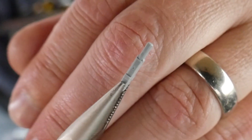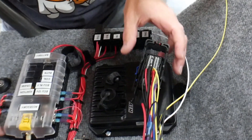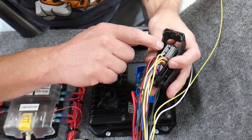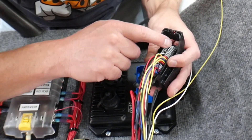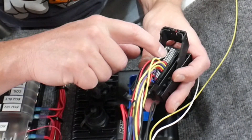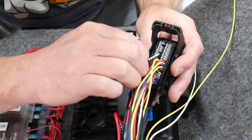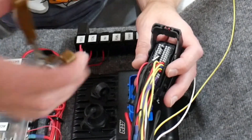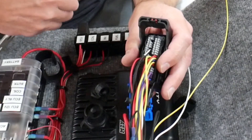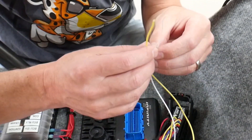That's just a little plug that pulls out of there. I took that out of 39 and now I need to find 52. Counting down from 60: 59, 58, 57, 56, 55, 54, 53, 52 — so 52 is right above that yellow wire. I'll grab that and again just twist it and pull it out of there. Now I'm going to put my terminals on these two wires.